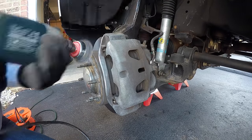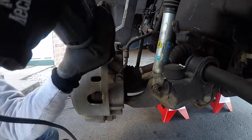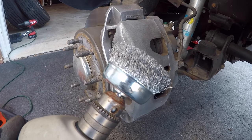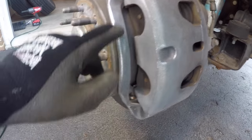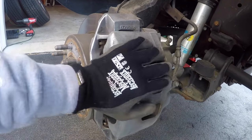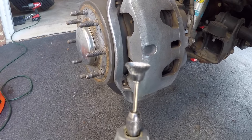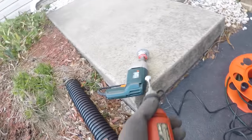After hitting the caliper with the forward-facing wire brush it did restore a decent amount of its original condition. You can see there's still some discoloration but some of the raw metal came back to life relatively easily. The caliper is still mounted on the truck — I like this because it gives me a solid working surface. Now I'm going to hit the tighter areas with the Dremel and the smaller forward-facing wire brush.